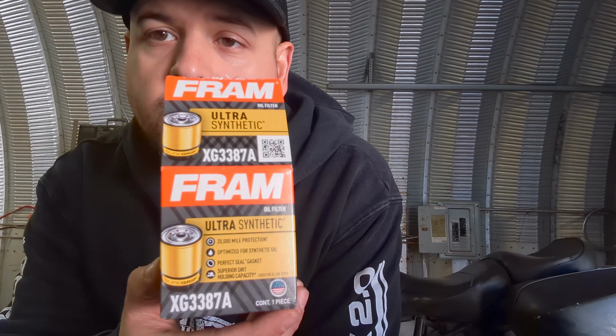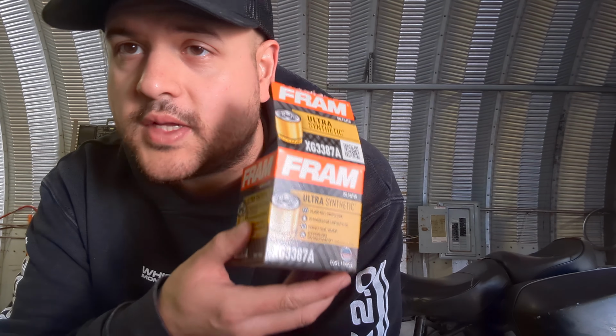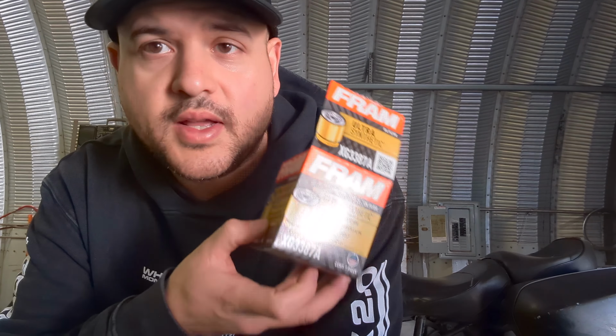So what do you need to do? Well, you need to convert it to an M18 1.5, which allows you to use a 3387A oil filter that's commonly available at any Walmart, any parts house in the United States. So what do you need to do that?